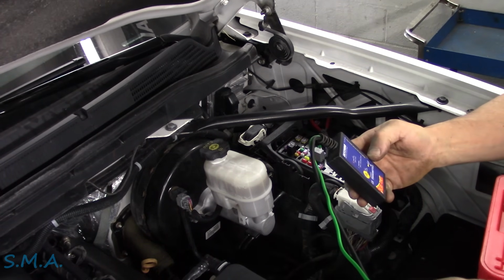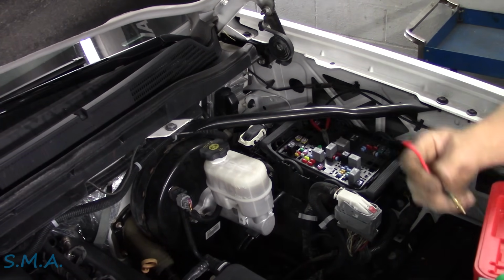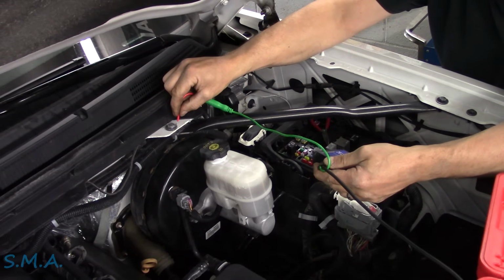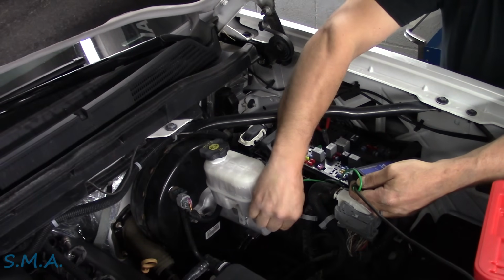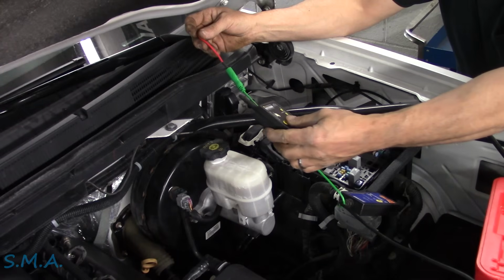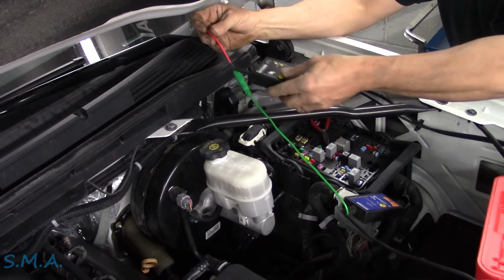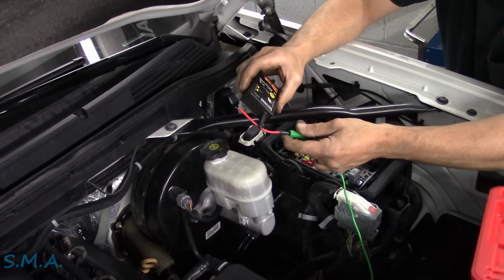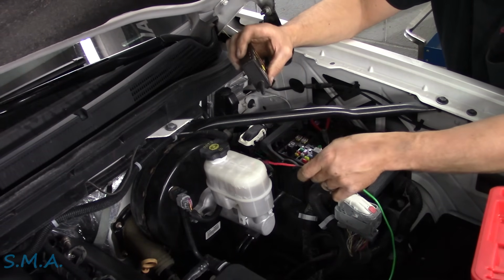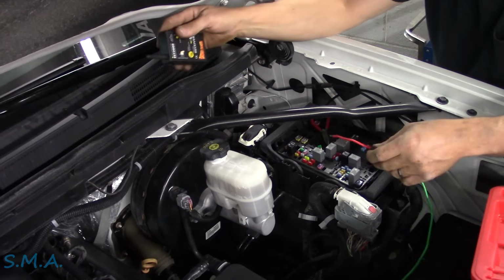Okay, so we've got this plugged into the battery. Oh, we don't want that thing beeping. And then we're going to use, I assume, something like this that we can just shove in the fuse box. Okay, and currently this says open circuited on the little indicator here. I don't know if I short it, if it'll say. Okay, so it says short grounded. I'm thinking this transmitter here. Yep, so as it comes down this wire, and then once we get past, it should send a signal. Okay, so that makes sense. And then if it was shorted to ground, okay, so it makes a different sound. So anyhow, I think we got the gist of how it works.